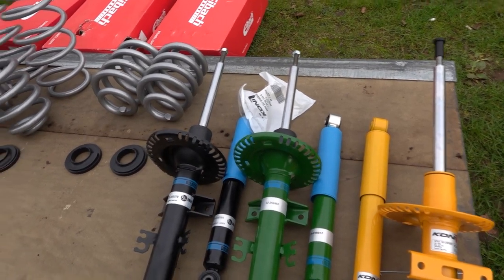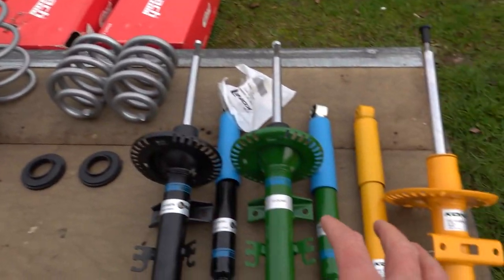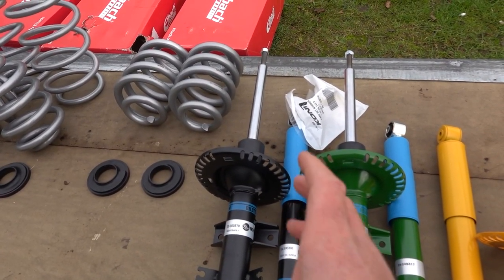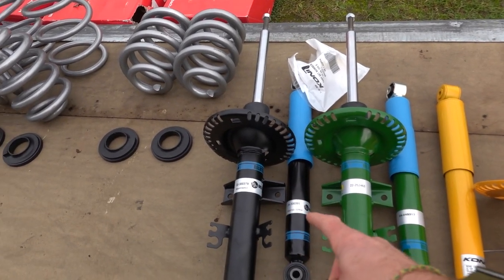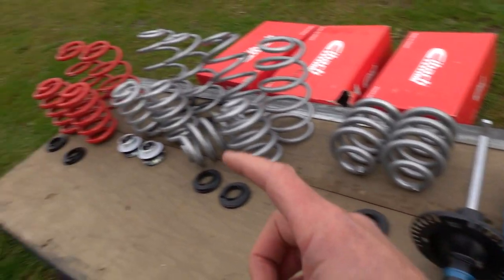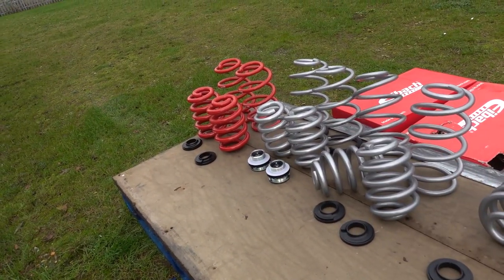From there you've got our Big H damper — that's the longest damper in the range. All these springs will work with all these dampers as they all seat the same, but if you're going for the extreme end of lift, this is the longest damper on the market — an extended B6 damper, extended even more. It works brilliantly with all of the kits but is really popular when going with the extreme lift of the Big H kit.